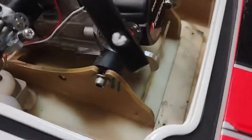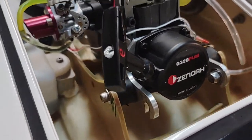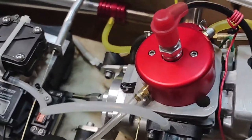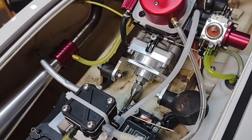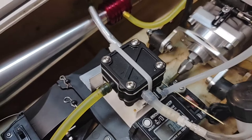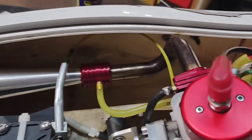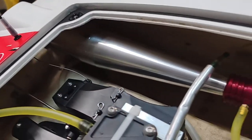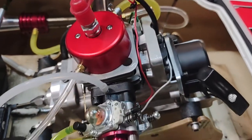Two more cc bigger engine here, a 32 pumper type carb. It's a bigger head, it's bigger. Weighs about the same, a little bit more, but it's a bit bigger, more torquier. Especially with this exhaust. I swapped out the stock exhaust, used the header, which that works, and the stock exhaust with the tune pipe from Bonsai. Now I just gotta break it in.